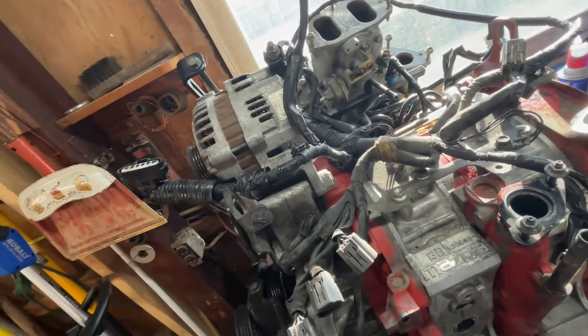At this point we're gonna start putting on intake pieces — I just gotta figure out what goes where. The relays in there are for the horn and for the fuel pump, because I wanted to turn the thing on without spraying fuel everywhere — I think it still has a half a tank of gas. I put fuel stabilizer in there, an entire thing of Heat and an entire thing of Seafoam, so it should be thoroughly stabilized. I still need to figure out where these hoses go. I probably should have done that before I put the alternator on — so that's probably gonna be the next step. I'll probably have to research some videos to see exactly where that stuff's supposed to go.